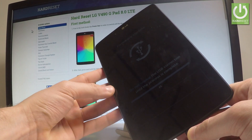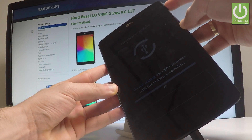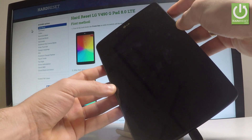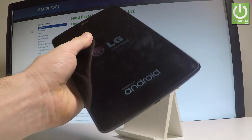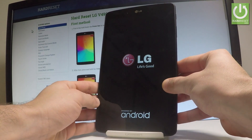If you are not updating your device, just press the power key. Keep holding power for a long time, and release power as soon as the tablet goes black. Now the LG is restarting and rebooting. You can disconnect your device from the micro USB cable and wait until the tablet is ready to use.